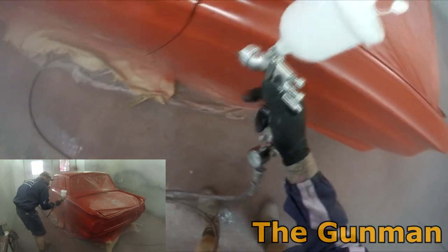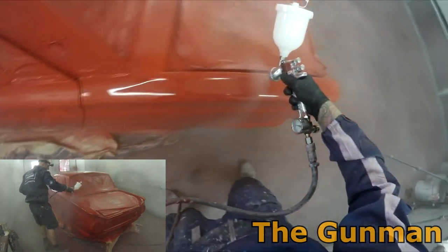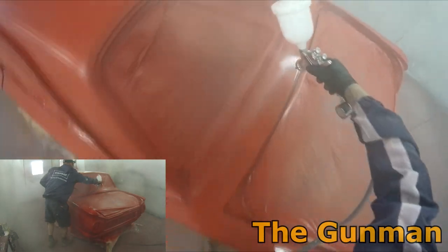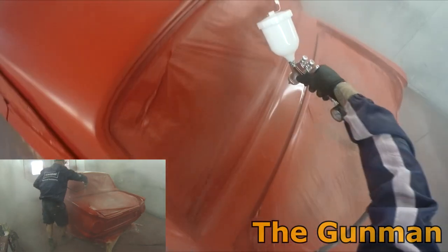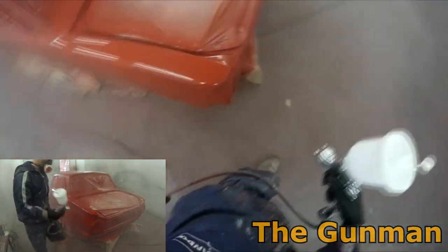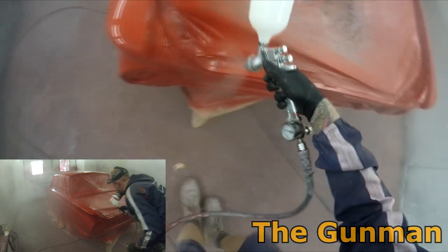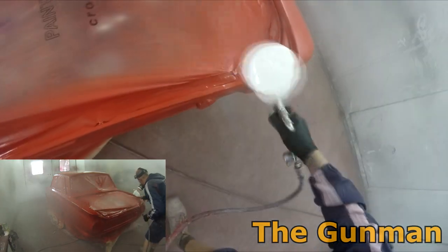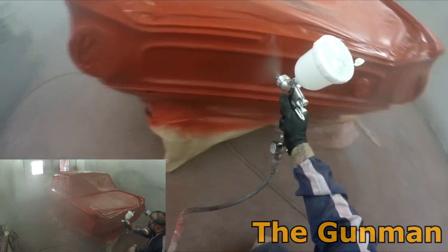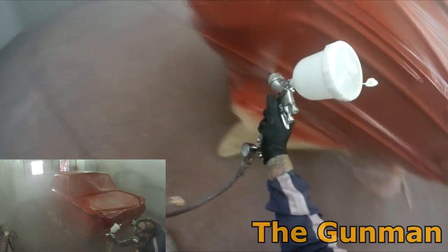There's a common thing said by painters, well, I don't see the use in water-based because you're still putting 2K clear over it. 2K clear is not as bad for the environment as the solvent-based base coats, which in many ways is very similar to the old acrylic paint, and it dries through evaporation of solvents, which is exactly what happened in the old acrylic paints. So you just fill them up with thinners, the thinners would evaporate and the paint would dry, whereas with the two-pack paints, it's the hardener, as I mentioned before, reacting with the clear coat that will make it dry.